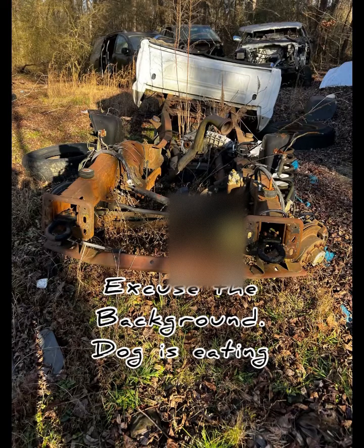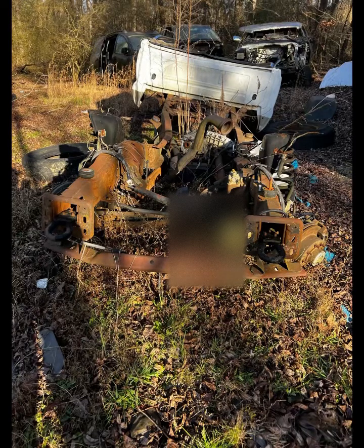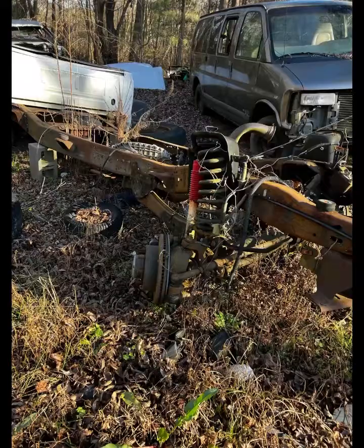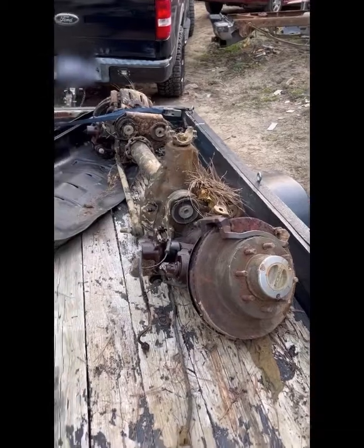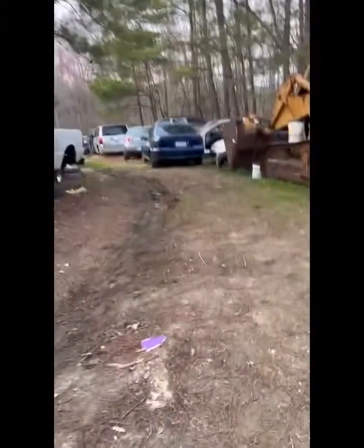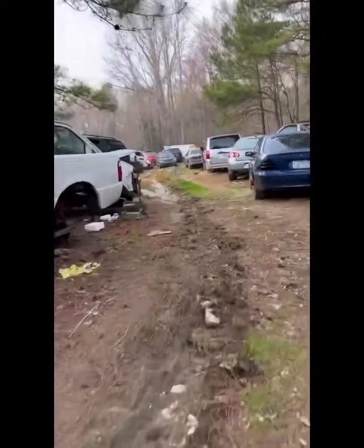What you're looking at is the F-350 single rear wheel chassis I found in a junkyard close to the house. The guy had it for a good while down in the woods and gave me a good price, so I figured I'd jump on it. It's going under the E-350 van. When I pulled the numbers on the front end, it's a Super Dana 60 with the 10-and-a-half-inch gear — big, as you can see there. Finally got it loaded; it took two guys and myself one afternoon to get it out.